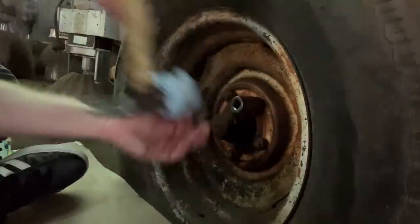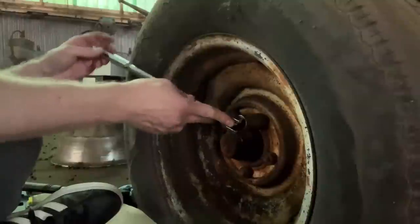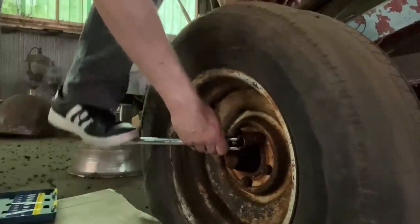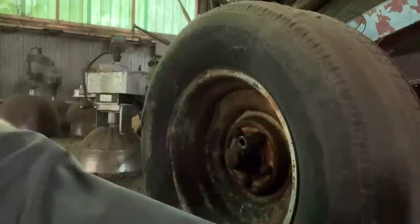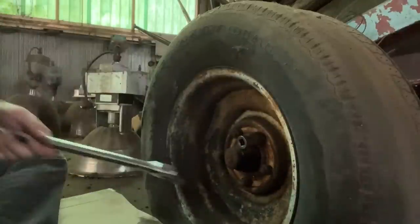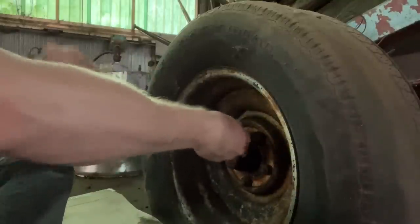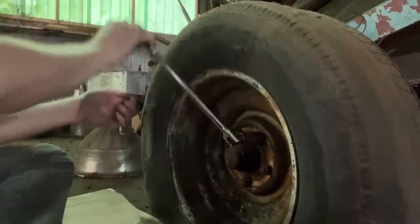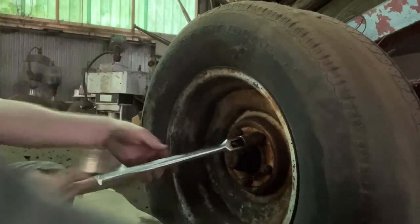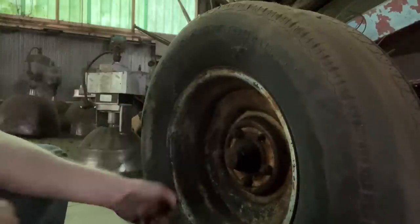Tap it on at a true 90-degree angle to the bolt, keep the hammer nearby in case you need to do that again, then put in the breaker bar and make sure you're locked in. A little tapping force, give it a leverage point — arm pressure wasn't doing it so I had to resort to the foot. Getting locked on tight, getting the bar back in — now it's responding to a little more arm pressure. I can start working around, adding a little upward rotation so the bit doesn't keep pulling down. And it just popped off.